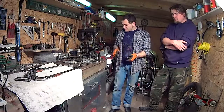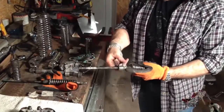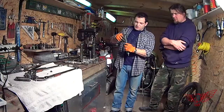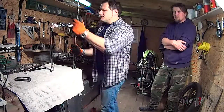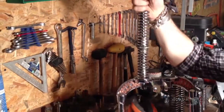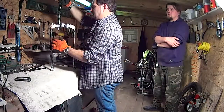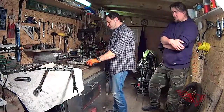So we start by reassembling the spring system by introducing the lower spring, which was labeled, inserting the stops right here, the upper spring goes right in there, we get our front springer, we set it down, we push the threaded rod through and we screw in the little bolt, just a little bit. We proceed with the second spring system.